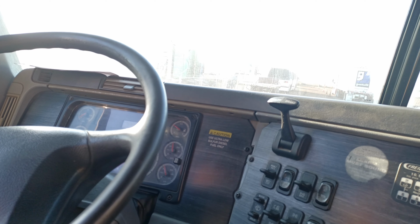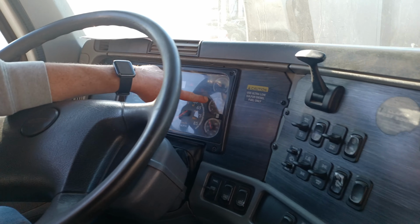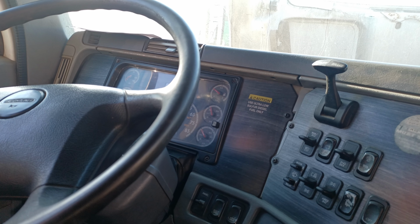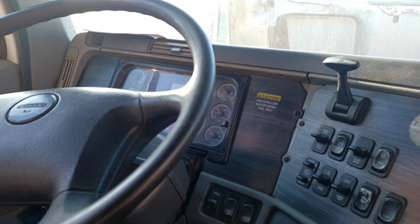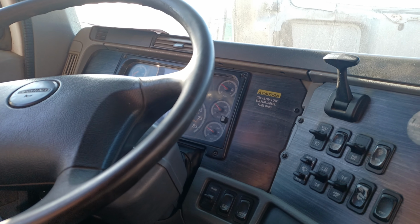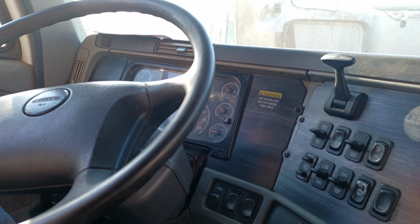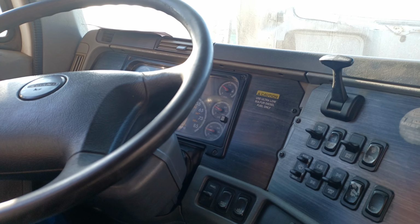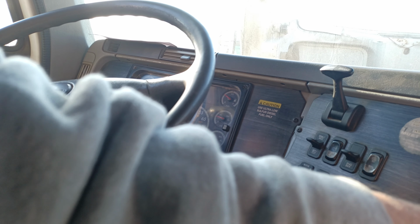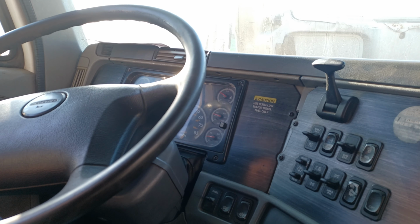Okay. My last test will be the spring brake test. The spring brakes should apply between 20 and 45 psi. And again, all of my tests are based off of this primary gauge. I don't need to be watching those. I'll hear those. I need to watch my pressure here, my gauges. So both the trailer and the tractor brake applied at 28 psi. So that was a good test.